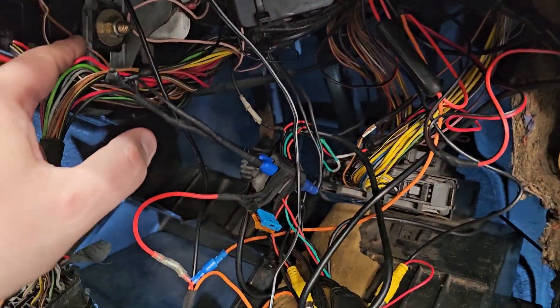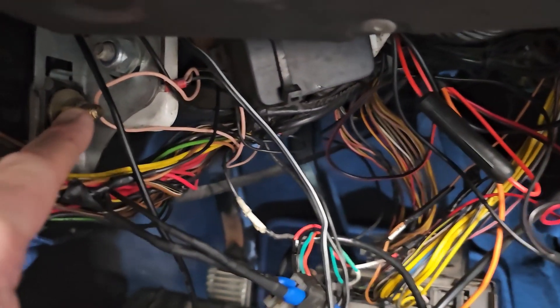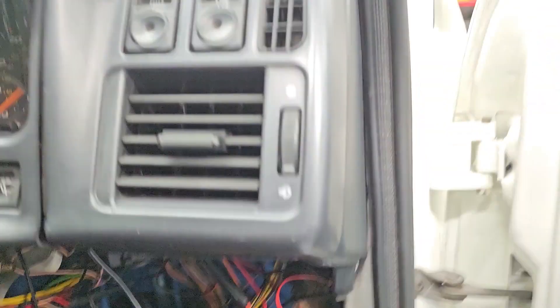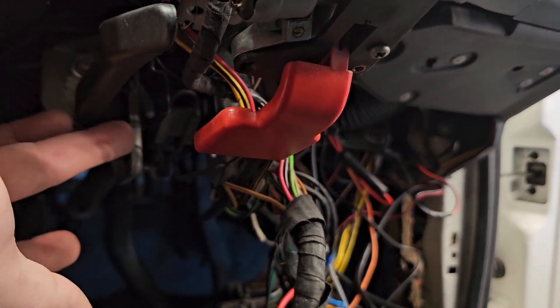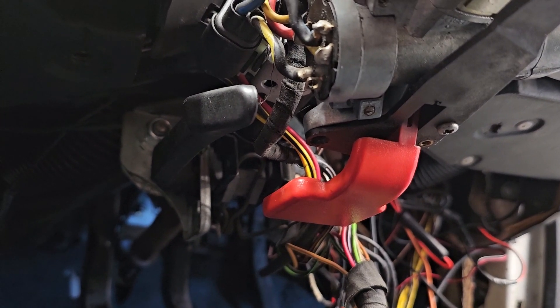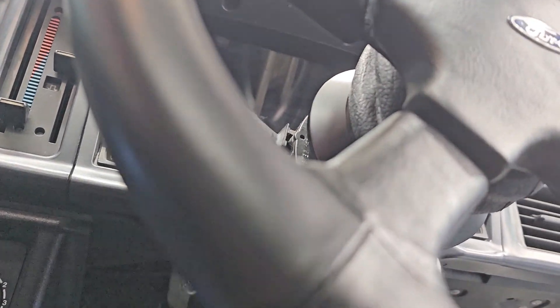I had a quick look at the steering column adjustment - rake and reach. As I said, when the clamp was in the clamp position it wasn't clamping well enough; if you leant on the wheel it would slide up and down or in and out. I've had a look and down here there's a nut that a 13mm socket fits over, and on the other side where the lever is there's a corresponding nut. I just held one still and gave the other a half turn, and as you can see it's now gripping nicely.